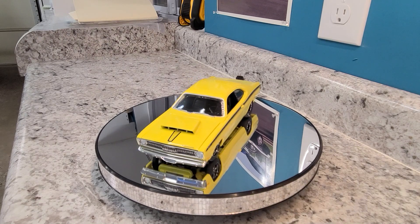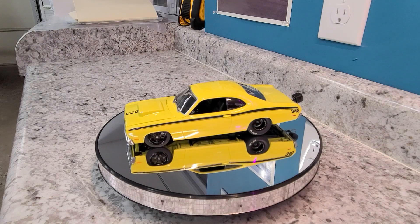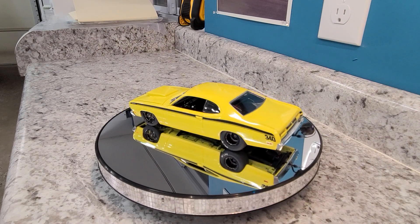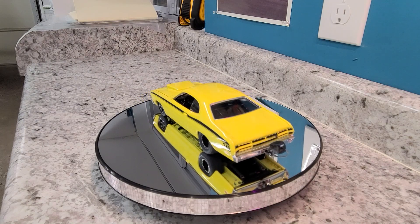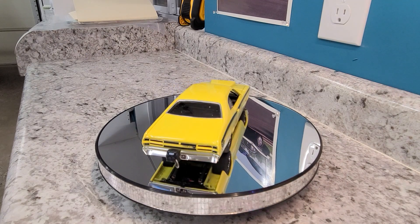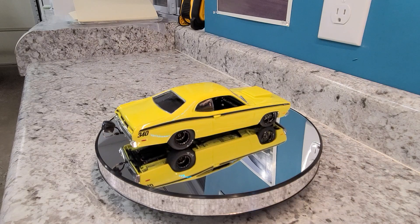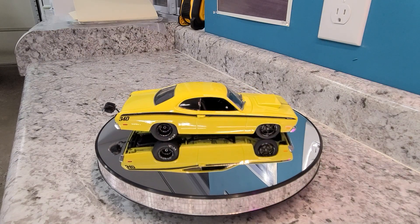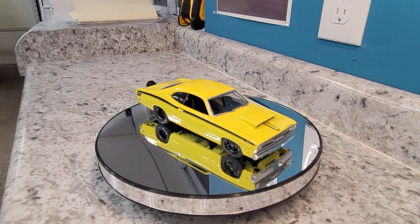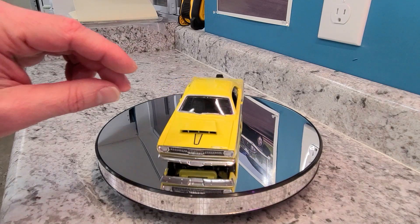I'm happy that it's this far along given the rush of the last few days. I had some issues with the primer going down — I was getting fish eyes in the primer and I didn't like that. So I ended up sanding it all down again and starting over, which I'm glad I did. I was kind of shocked because I'd scrubbed the body really well and scuffed it with 800-grit sanding sticks. The body wasn't really flat in a lot of the lines, so I sanded it and got the bodywork pretty well. It must have just been oils coming out from the plastic.